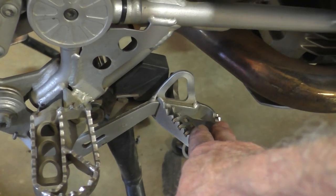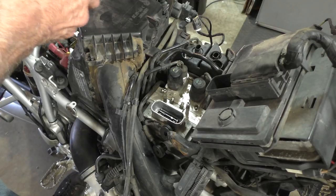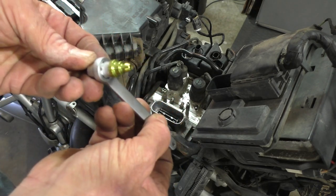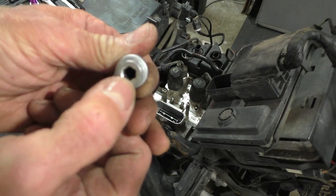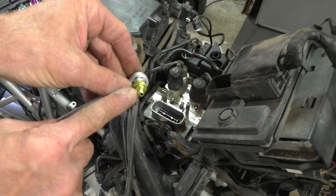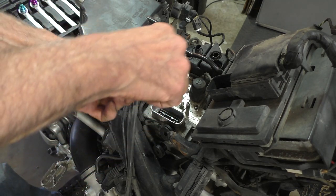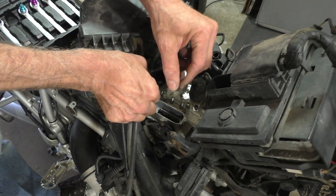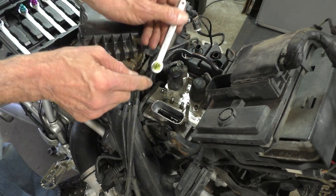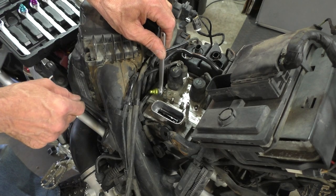We'll be working with the rear brake lever, pumping and bleeding up at the ABS pump. These are all seven millimeter sized bleeder screws. This tool has a rubber O-ring seal inside that seals when you push it onto the bleeder. There's also a check valve — it only lets fluid come out, doesn't let air or fluid back in. You put it on the bleeder valve, open it, and you can just leave it open and pump away instead of the usual open-close routine.